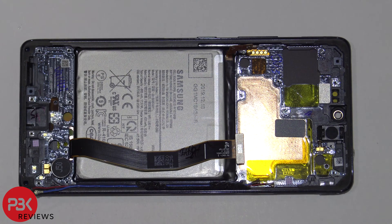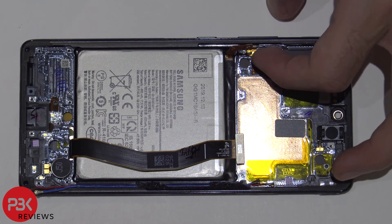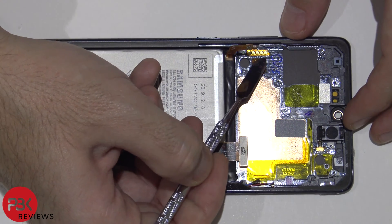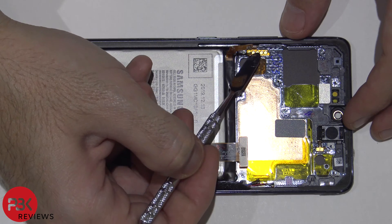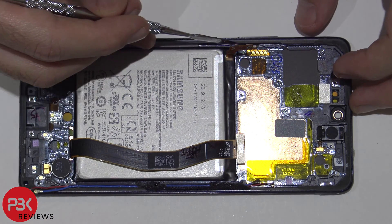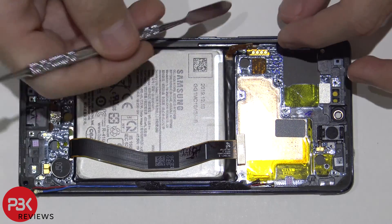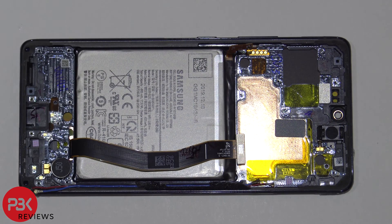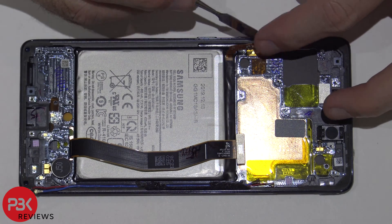As far as the power and volume buttons go, they're on the side over here. You'd have to gently pry off this flex cable, which has the gold dots that make connection with the board. Pry that up a little bit — be careful not to tear it. You have a plastic bracket over here sitting in the mid-frame. You'd slide that bracket up and pop it off, which gives you access to removing the flex cable for the buttons. Once you remove your flex cable, it'll give you access to pushing in these buttons so you can remove them from the inside of the frame.